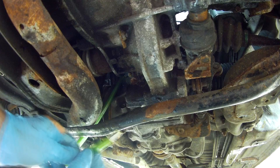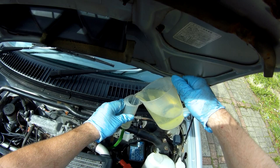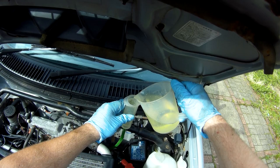I pulled out the GL5 oil for the transfer case and measured how much I needed. Look how clear it is compared to the old stuff. Then in it goes. Generally the capacity for drivetrain components like this is literally the capacity — if you try and put more in it'll just fall back out. But there's no point wasting oil, so measure it and then add a tiny bit more if you need to.